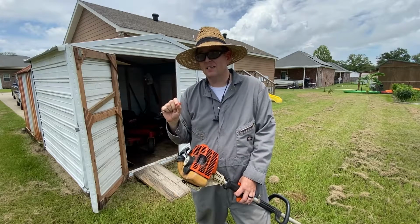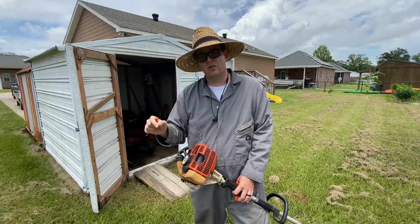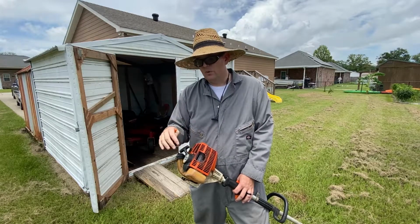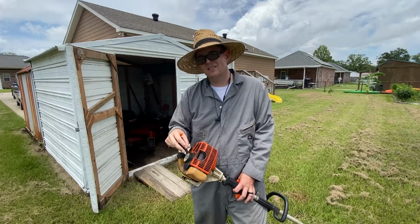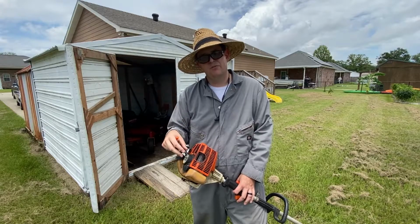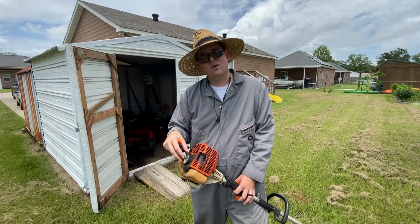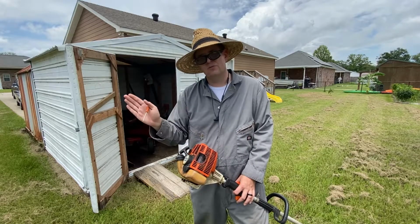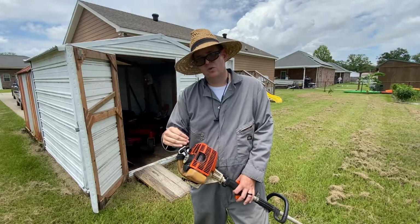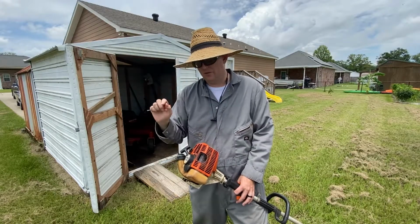And then the very next thing I'm going to do is let go of the throttle and watch the smoke trail coming out of the weed eater. You want the weed eater at wide open throttle to have either the very slightest amount of smoke trail or a good healthy four-stroke. Otherwise it's too lean. But you can tell if it's correct even if you can't see a smoke trail when it's four-stroking, because whenever you lift off of the throttle, there'll be so much extra oil left in the cylinder from it being properly lubricated that it's going to leave a smoke trail. So let's watch that.